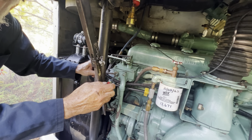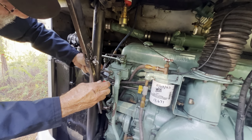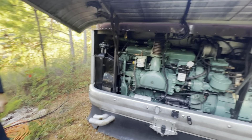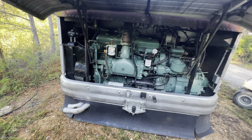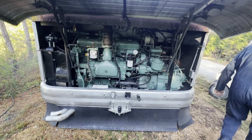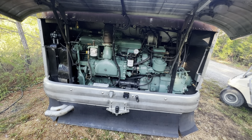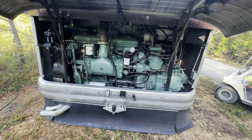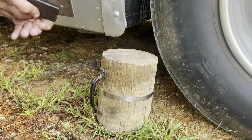We just put the Delo 100 — it's a straight 40 weight oil — in it. Another fresh oil change, no diesel or anything at this point, and another brand new filter. It's a cold start in the morning, in the 60s so it's not super cold but the engine's cold. If it still has a hunt we haven't addressed that at all, because it wasn't hunting like that before this issue. We think all that slurry of crap in there was messing with everything. But if it still has a hunt, he's going to crack that little adjustment jam nut loose and run that screw in just enough to raise the RPM about 15 to 20 RPM and it'll smooth right out. So if it has a hunt right at the start, immediately get on to doing that — don't let it warm up and go away, let's take care of it right at the beginning.